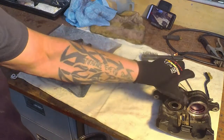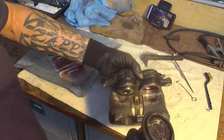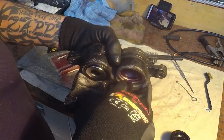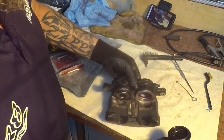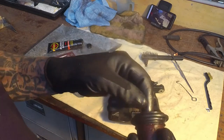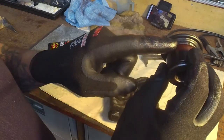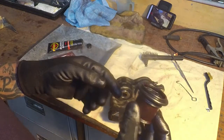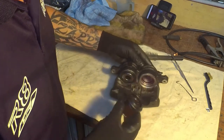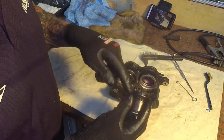Your piston is all greased up, the inside of the caliper is all greased up, and you have your inner square cut seal in. What you're intending to do is get the bottom edge of the piston and insert it into the bottom edge of the groove, then maneuver it so that the entire edge pops into that seal. I've seen people try to put the dust boot on first and squeeze the piston inside it, but I think that's just way too hard. The trick is to hold it because with all the grease it'll just slide straight off.